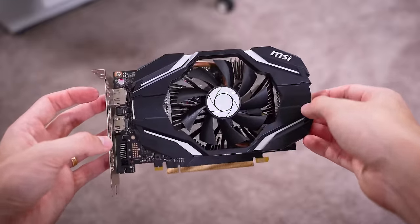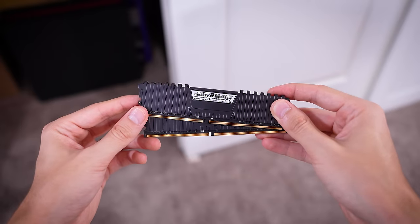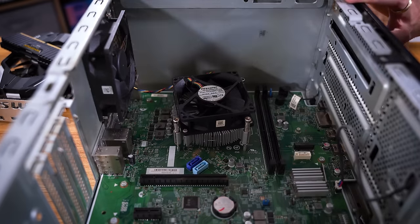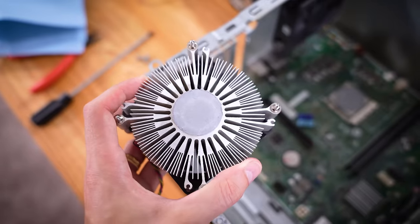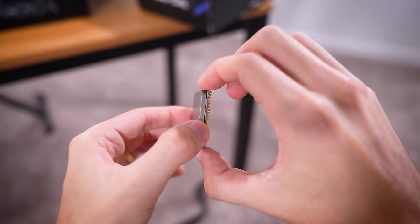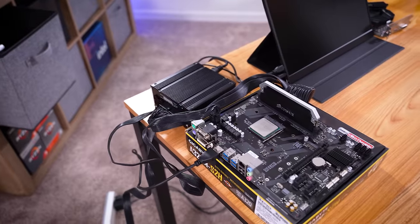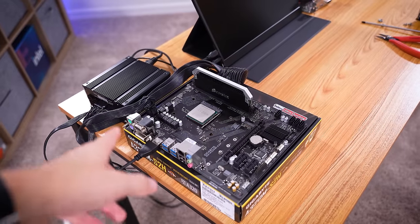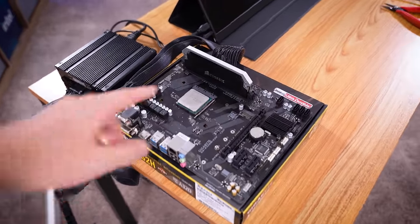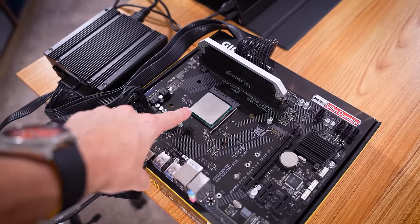I don't expect the GPU will prevent the system from powering on at all unless there's a serious dead short somewhere. But seeing as this is one of the more expensive components in the rig, I think it's safe to rule it out as quickly as possible. Same goes for these DRAM modules — even though DDR4 is quite cheap today, it takes literally seconds to verify they're still working. The last thing is the CPU under this cooler. I'm going to strip it from the board and test it independent of everything else in a known working AM4 motherboard. I've set up a makeshift workbench with an A320M — I chose this intentionally to make sure we didn't run a newer board that could have potentially nuked 2000G series APU support due to BIOS chip size. We've got a single 4GB stick of known working DDR4, the board and power supply are both known working. The only thing from his rig is the 2400G.